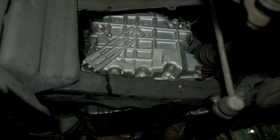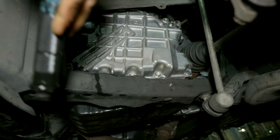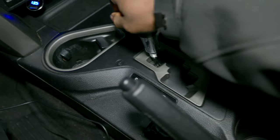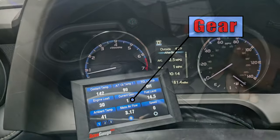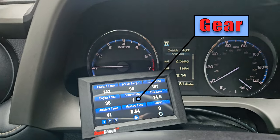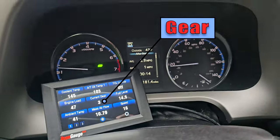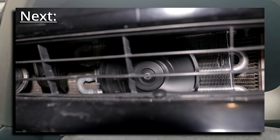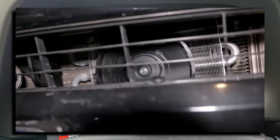Next is the fill plug. We are all set. Next I'm going to cycle through the gears: Reverse, Neutral, Drive. After doing all of this, you want to make sure you take it for a short and slow drive to make sure the gears are shifting properly. Then come back and check the transmission fluid level again and top it off if needed. I will be making a follow-up video on this transmission cooler, so remember to subscribe so you don't miss that. This was my video on how to install a transmission cooler on a car. If you have any questions drop them in the comment section — thank you for watching guys, I'll see you on the next one.